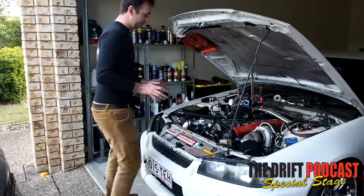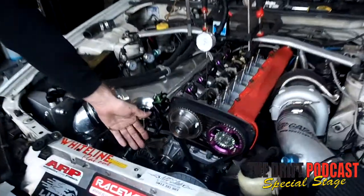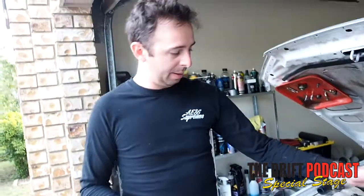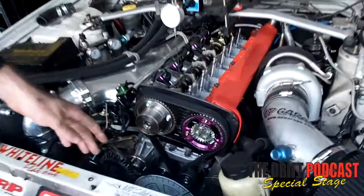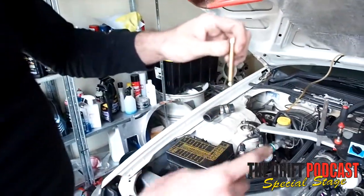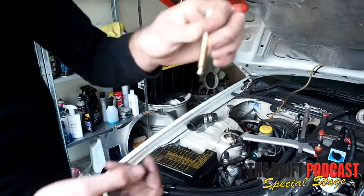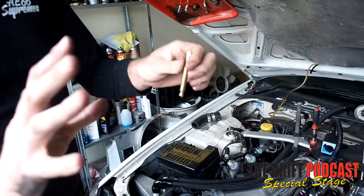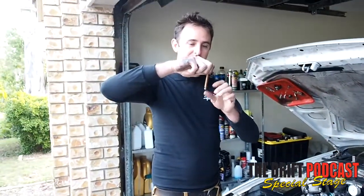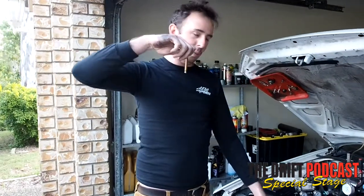On the crank we have a cam timing degree wheel — these can be had for about $50. We then have a pin showing our top dead center mark. We use a piston stop, which half of it is inside the spark plug hole at the moment. You thread this inside, sit the degree wheel at what you believe to be 10 degrees, then tighten it down just so it touches the top of the piston. You then turn the motor over — the piston will go back down, come back up, and hit on this. Then you read what it says there and figure out where actual zero is.